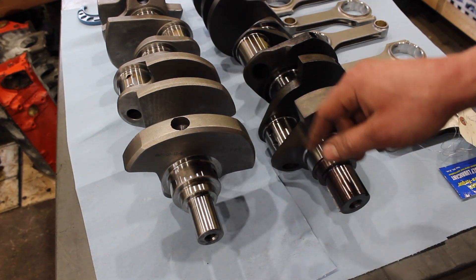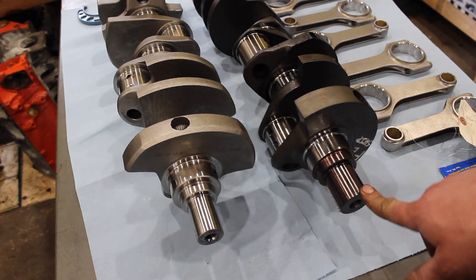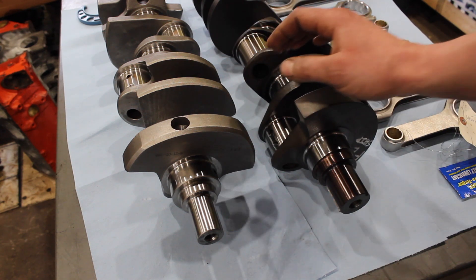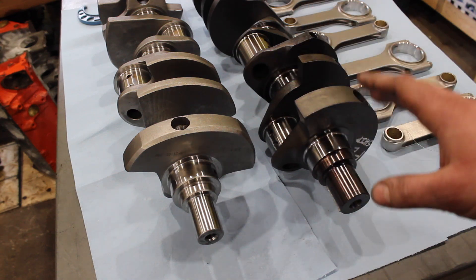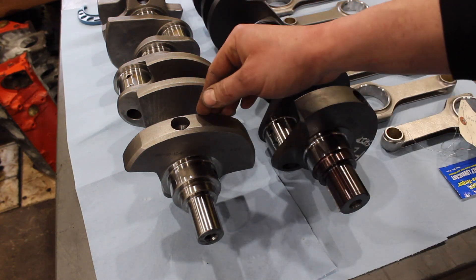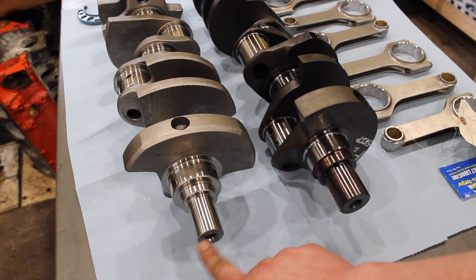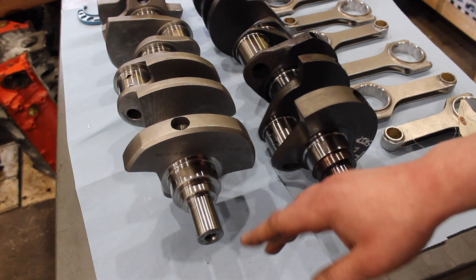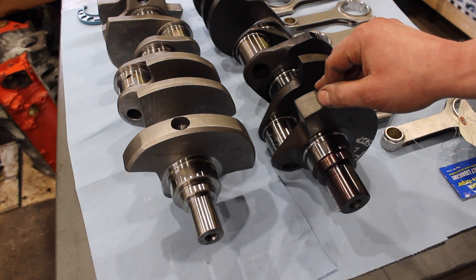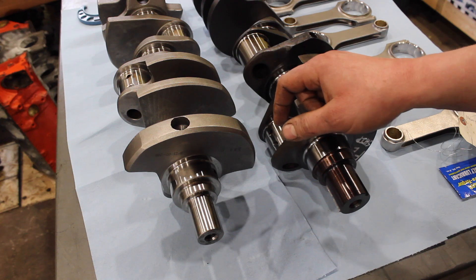The reason I'm doing this and rebuilding this engine is right here — this is for my buddy's 383 stroker. It's got a 671 blower in a 66 Chevelle. The first time we built the motor it was just a real basic blower setup. We used a forged crank but in the same stock snout configuration, and it worked fine with the old blower. We ended up switching to a bigger blower — a Blower Shop EFI blower, which is a Teflon strip blower — and started pushing things a little harder.